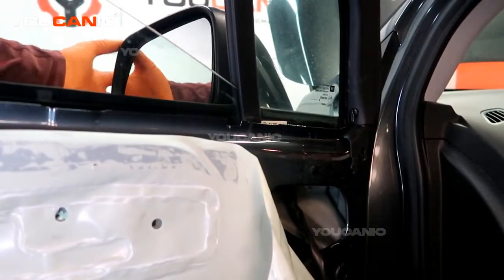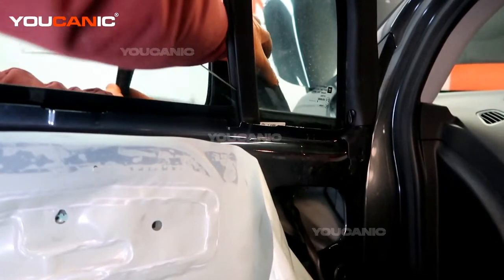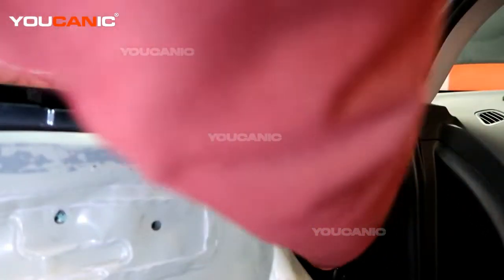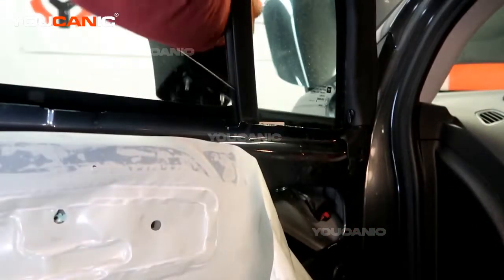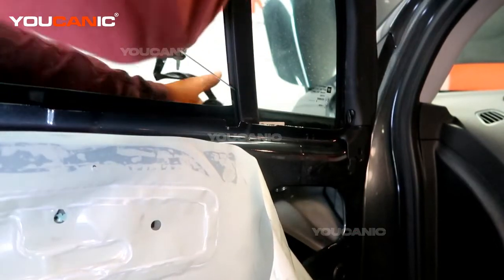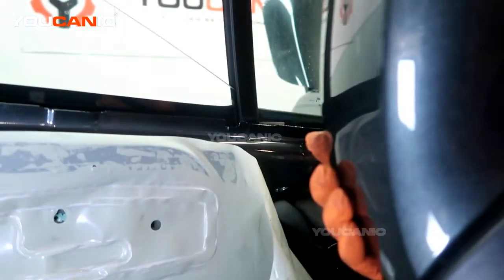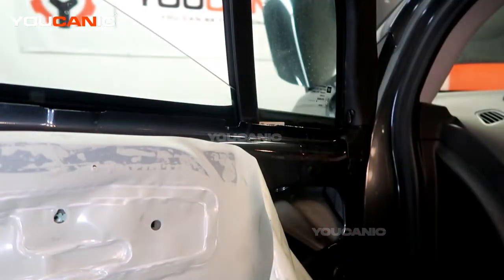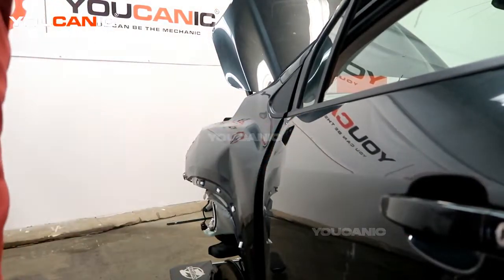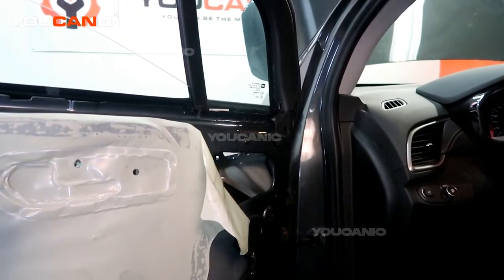I have my hand around the outside holding it so it didn't fall off, and now we're able to just work it out, running the electric wire through the hole. Now we have removed the whole mirror housing. That's where the mirror attaches through, so when you have your new mirror you'll just go back in reverse order.